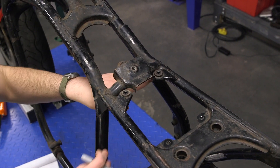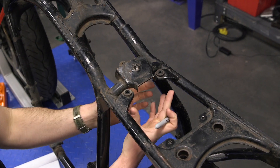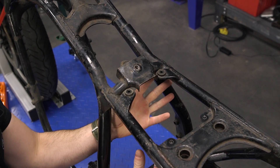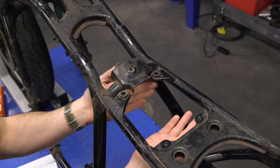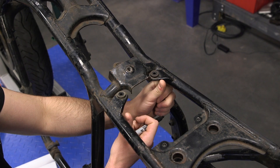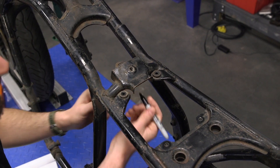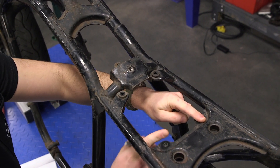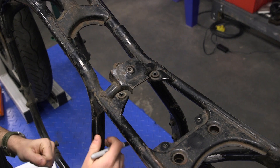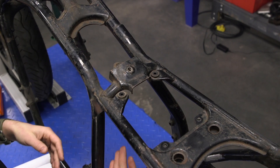We're going to come down to about this point where the frame rail changes its direction and bends a little bit, and we're going to follow that along to the back. This shape back here is a little bit of a trapezoid — it's a little tight up here and gets a little wider as you go, but it's going to be flat. We're going to bend the sides up, run them really close to the frame rail to get a little airflow but no water. Then we'll do a 90-degree bend, make a tab over these factory mounting holes, drill some holes and run bolts through to attach it. So let's go back to the cardboard, get the shape on paper, put it up to the bike and see what we like.